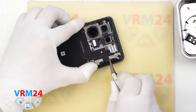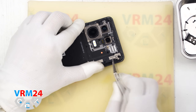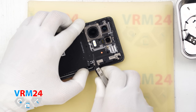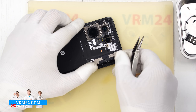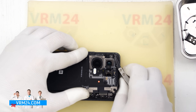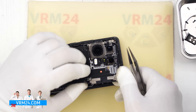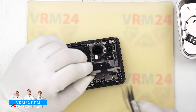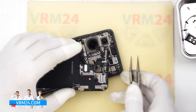This cover is also not easy to open, so we need to be really careful. Please note that there is a cable coming from the cover — the cable goes to the motherboard and most likely goes to the flash tube. Do not pull the cover up too hard so you don't accidentally damage the cable.